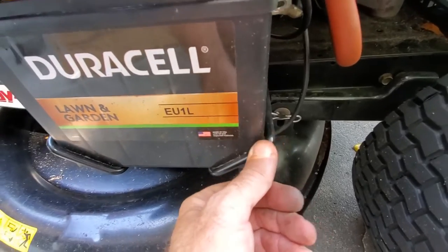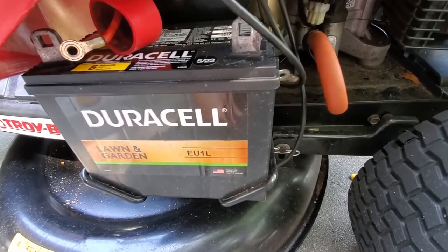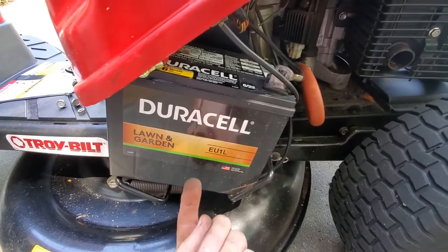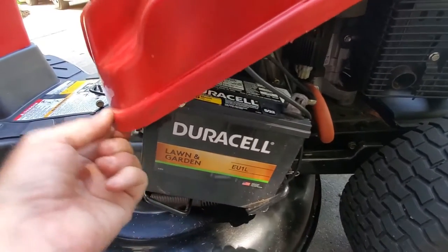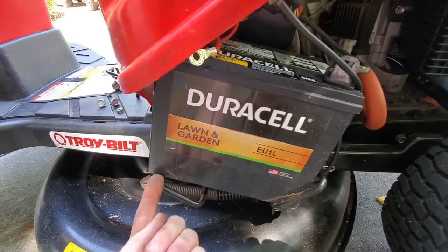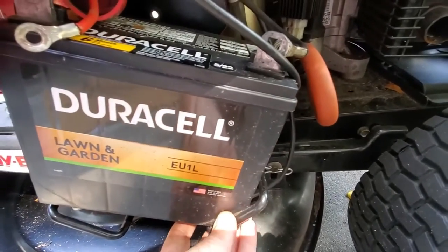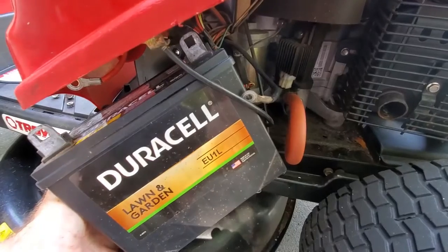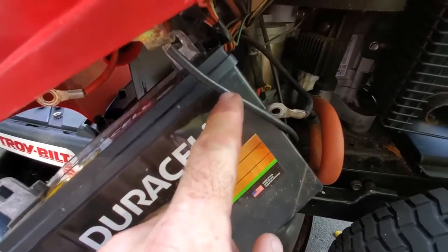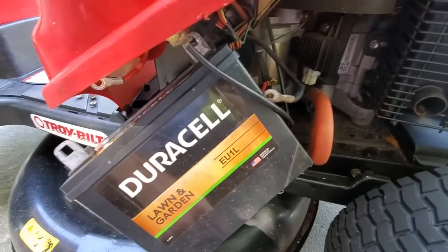Now the battery is loose. Basically all you got to do is pop the bottom corner of the battery up over this holding bracket and then the battery will come out. Actually, the easiest way to get it out — I forgot — is you lift the battery straight up. It will hit this plastic shroud but it moves enough to get it out of the way. Lift the battery straight up, kick out this side, rest it on the frame, then lift the battery up and out. The only thing you may encounter is you'll have to fight the throttle cable — just push that around as needed. As you can see, the battery is coming right out.